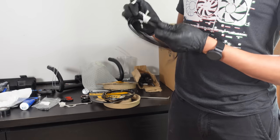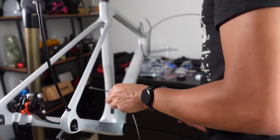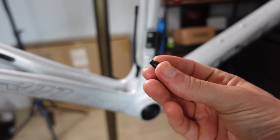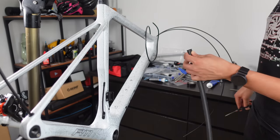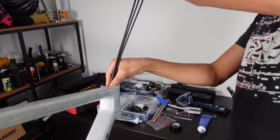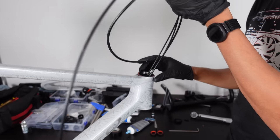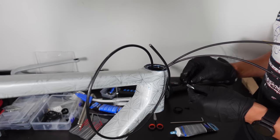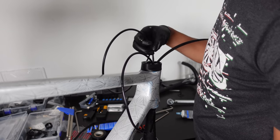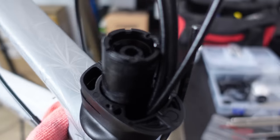With the brake sorted it's gear time. After straightening the cable as straight as possible we began with the rear derailleur — threading from back to front it was smooth sailing. The front derailleur was equally cooperative. We also added a blanking grommet to the frame where the DI2 wire would typically go, and checked the dampening hose that came with the frame to ensure it was the right length — Johnny chose a size that will comfortably house the cables ensuring a rattle-free ride. Now we need to get the headset on. First give the upper headset bearing seat a good greasing, then thread the bearing over the cables and settle it into the bearing seat. The bottom bearing seat and bearings get the same treatment. As we slide the forks through the frame it's crucial to ensure each cable is precisely where it should be — get it right now and you'll save yourself lots of tinkering time later.